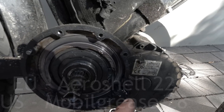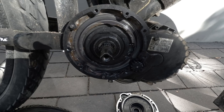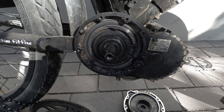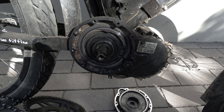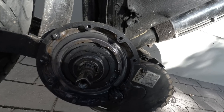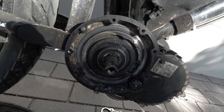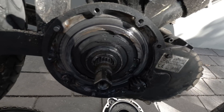Replace it with that grease because it's suitable for contact with the nylon gear at the back - some greases degrade plastics, so it needs to be an aerospace plastic-rated grease. Fill it with grease as you can see it's got loads in there, which helps keep moisture out almost as well as the rubber gasket.